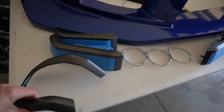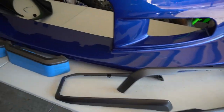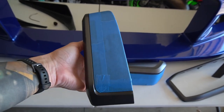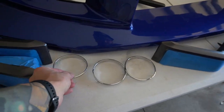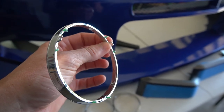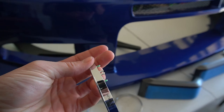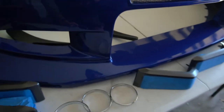I removed everything from the dash trim panels last night — there were four or five screws on one edge and quite a few on the other. I went ahead and taped up the door trim; just went real careful around the edges and got it all nice and sealed off. I also removed the chrome vents. They have little plastic tabs that run through the dash panel and are melted on the other side, so I took a flathead and popped off the tabs — we'll have to glue those back in, maybe heat them a little. Had to get them out because I don't like the chrome.